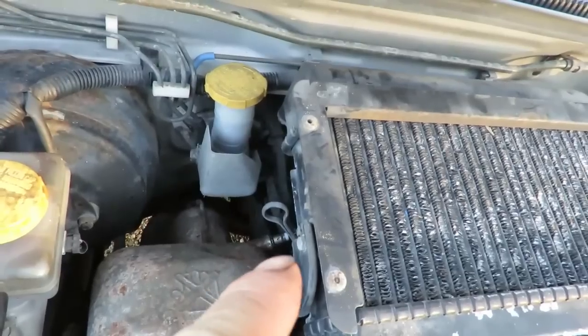So what that oxygen sensor there does is when the car is at idle, okay, it judges how much unburnt fuel is coming through into the exhaust. So then the ECU will lean out how much fuel is getting fed into the engine. Once you come off idle and start accelerating, okay, that sensor is pretty much useless. So it needs to then judge how much air is getting pulled into the engine to set the fuel ratio, so it'll increase fuel to the injectors as it senses more air.